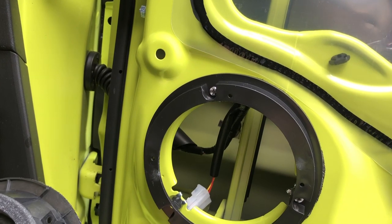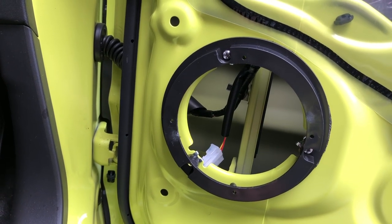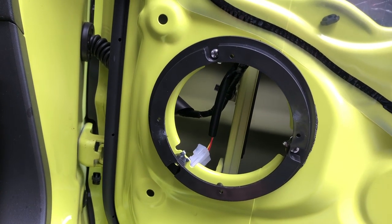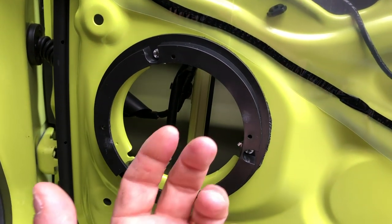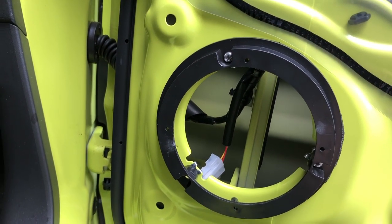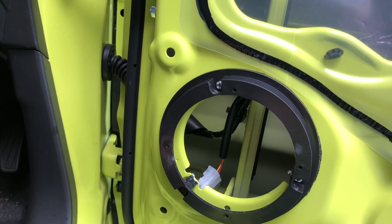The space that's actually available is a key factor in choosing the speakers you want to fit. The speakers themselves need to be 13-centimetre speakers — that's 5.25 inches — to fit in the hole. There are a couple of other critical dimensions: the depth available for mounting the speaker, and the depth available externally between the mount and the door panel. I want to check those dimensions as I think that will help you choose a speaker.